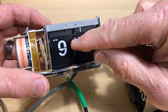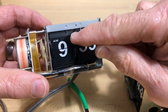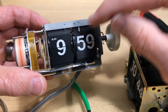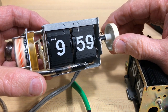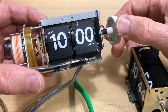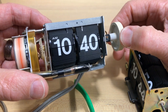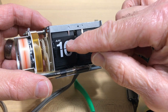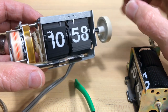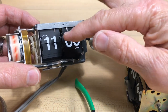What's holding the spring over is an increase in size — a projection from the 59. Once that projection moves past, we go to the hour. For the clock to work correctly, that spring needs to be working right. Around 37 minutes it's pushed over but not doing anything yet, then it catches the next digit — the 11 is behind there, replaced by the 59 which holds the spring over. Once that clears, we're good.